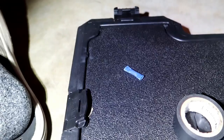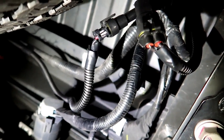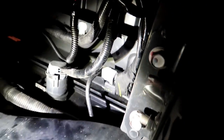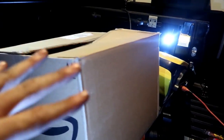Let me take you down below to show you what I had to redo. Those crimp connectors were crap so I took all those out. You can see where there's the heat shrink wrap — these are now heat shrink wrapped. The electrical tape is just to hold the plastic loom wire together. Just got to do a little bit of holding up the wire with some more electrical tape. As far as everything is concerned, the bed lights are on, they're nice and bright. The instructions have it wired so that these will turn on when your bed lights themselves turn on. So when those turn on, these turn on — works out great. I'm going to button up everything because it is like 8 o'clock and I still have a dinner.